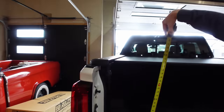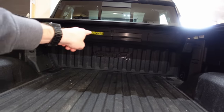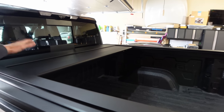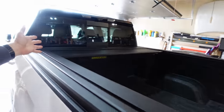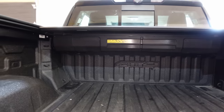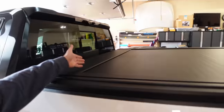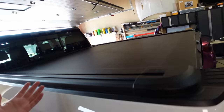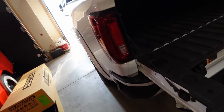Compared to my old flip cover I actually have more headroom. The front canister uses less space than some other designs and has a slope on each side for more effective drainage. Similarly to the flip cover this blocks off a portion of bed space at the front, but the difference is I don't have panels blocking the back window, which looks nicer and is more usable. The canister construction is heavy duty to resist impacts — it's not going to crack the first time something bangs into it. Each aluminum slat has an interlocking design with weather stripping in between, making it watertight. Water sheets off the top; any water that falls in exits through the gutter channel and then through all the drainage tubes in the canister or bed rail, exiting onto the ground.